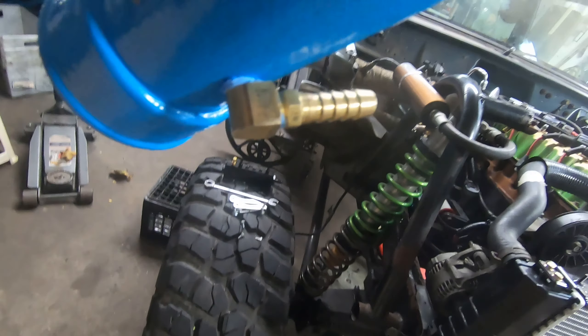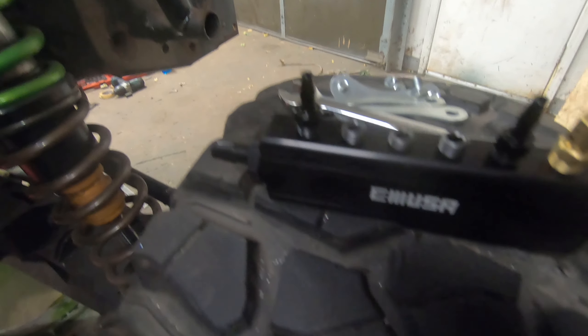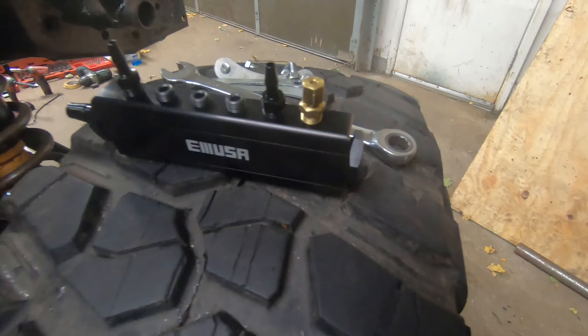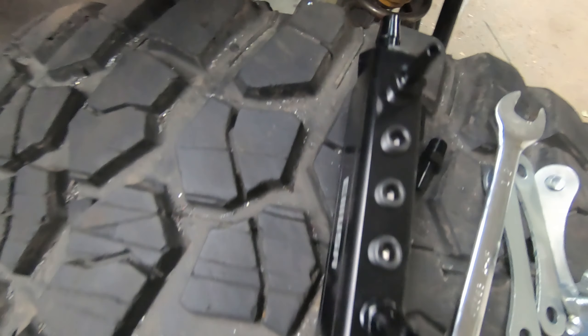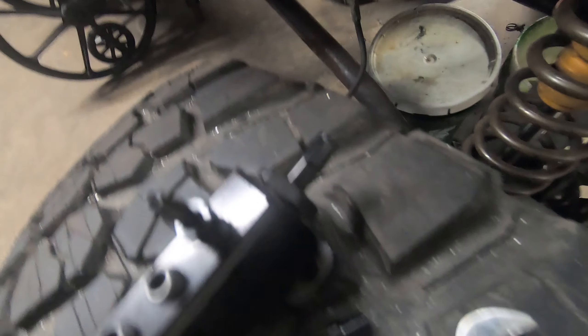As you can see, we drilled and tapped our compressor housing here, so that line will go on there and run under the turbo through here. We're mounting a distribution block on the firewall — it's a regular distribution block with a bunch of 1/8-inch NPT threaded holes, plugs, a couple barb fittings, and some Dash 8 or Dash 10 O-ring AN fittings on the end.